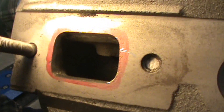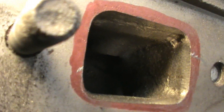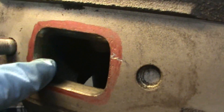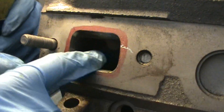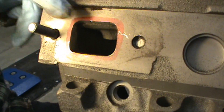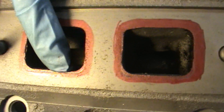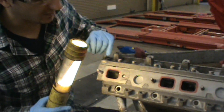When you come in close, you can actually see how far in we've taken material — look on the right side here. You can see we've taken off material and there are no scribe marks left on the outside. Basically all I'm doing now is feeling inside the port to make sure there are no huge nicks or anything that protrudes out that would stop the flow of air from being smooth in there. This one looks pretty much finished. The next step would be to take our gasket, put it back on, and see if we see any red spots anymore. Then we'll move on to the next exhaust ports and finish all these up. Once they're all dialed in, we'll get our gasket, stick it back on, and do our finish up.